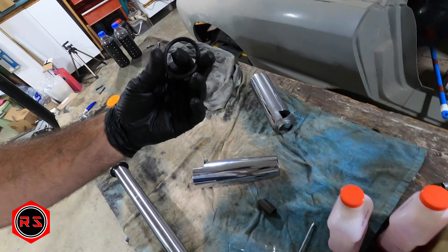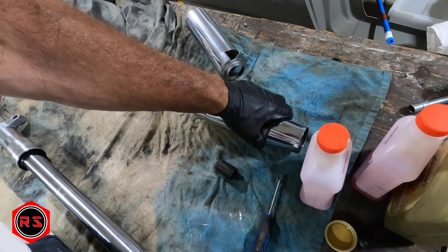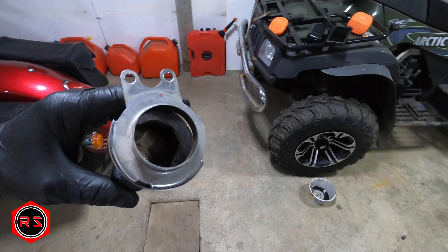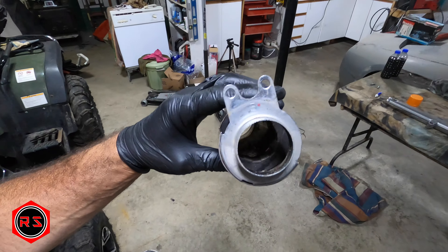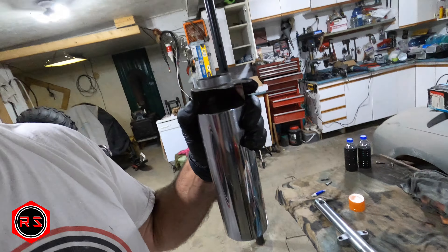I don't even know if the real name is 'chrome bottle' but it looks like a bottle. The top o-ring is there — it's not a big trouble. All these rubbers are there to keep things free from vibration or rattle. The problem is the big rubber ring, almost an inch thick, under the triple tree plate. That rubber ring grabs onto the fork like crazy, so you have to spray a lot of WD-40 to be able to slide the fork out of it.